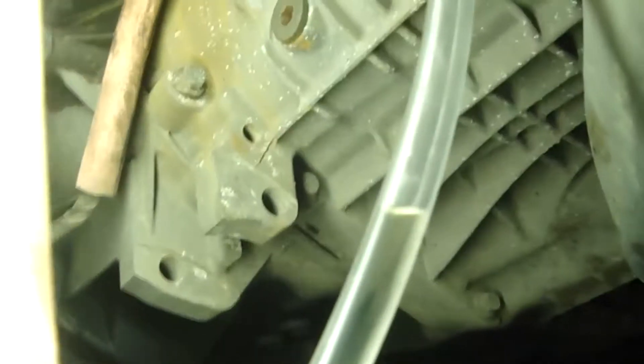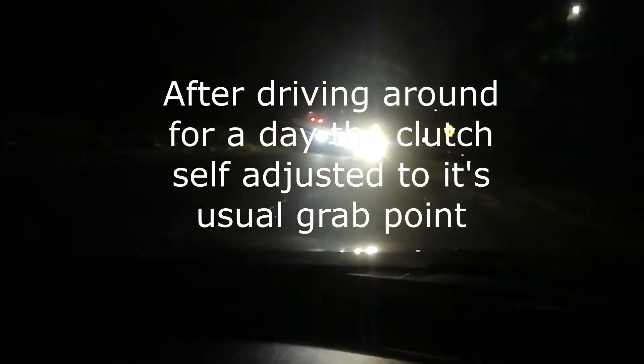Since I have to re-bleed the clutch again, I'm going to show you where the bleeder valve is for the clutch - it's under the car on the bell housing. The manual bleed of the clutch did the trick, however I had to do it several times. I had to pump that clutch about 30 times to get the air out, and I noticed the clutch is grabbing a lot earlier than it used to. The bleeder screw on the clutch, if you have a Ford Contour, is 8 millimeters. So to do the whole bleeding process you need an 8, a 9, and an 11 millimeter wrench. Thanks for watching - bye now.